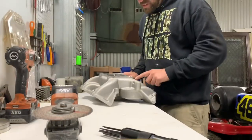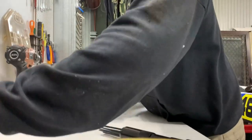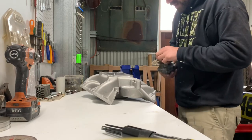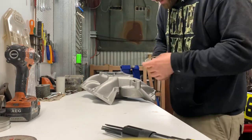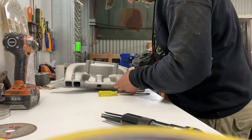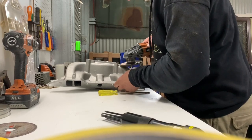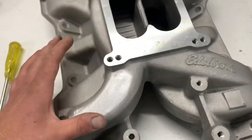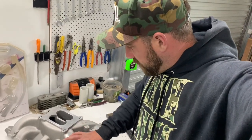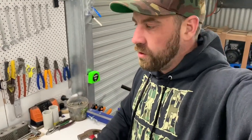Okay, so first off we're doing some grinding. I'm going to get my flapper disc — it's totally thrashed, probably not going to work very well — but basically we're going to get Performer RPM off, Edelbrock off, and Made in USA all deleted. As you can see, I've only done one side, and I've used a flap disc even though this thing is thrashed out. I find that they give a lot nicer finish and they're a little bit easier to control than a stone disc.